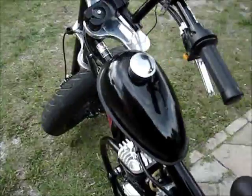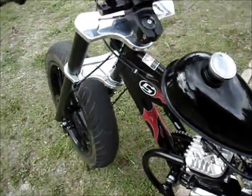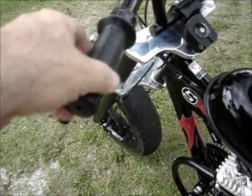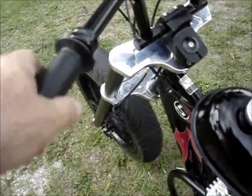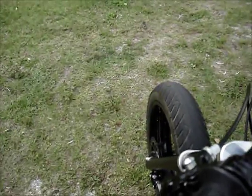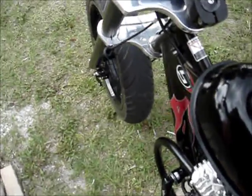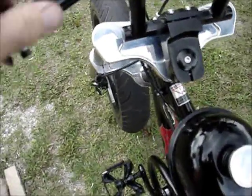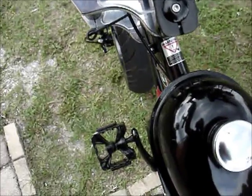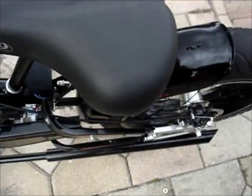Come over here. I've got the bike on a piece of ground where the front wheel is elevated slightly. That way I can lean it forward when I go to kick it. You have to have the clutch disengaged. Pull the pedal back like this and you'll be tilting the bike forward so that the rear wheel is elevated off the ground so it's not dragging.